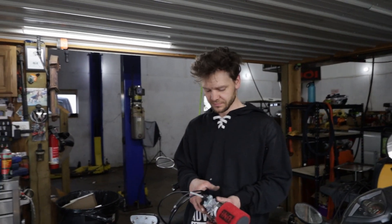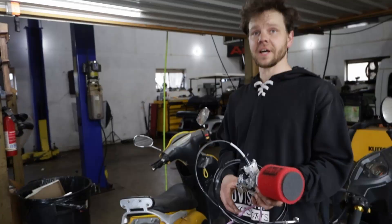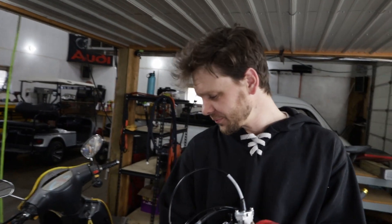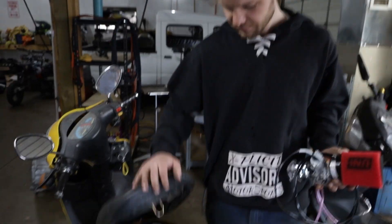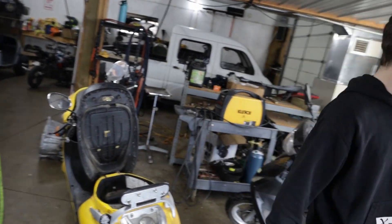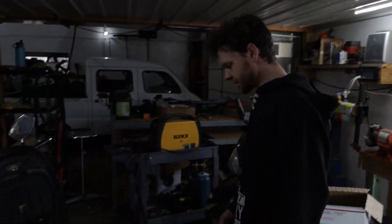This won't fit on yours — it's only for the 150cc. So it will fit on your scooter and it's going to also fit on the Jeep; we can test out both of those. Now I just got to figure out how to take this thing apart again, it's been a while. It's been running pretty good — I put it together for the first time and that was it. Just for you guys' information, this scooter does have lighter variator weights, 13 gram weights, and that made a really big difference.